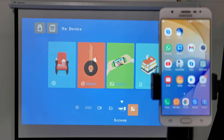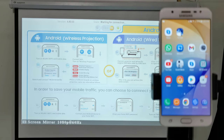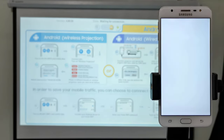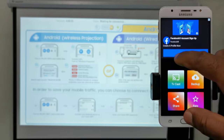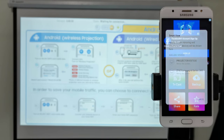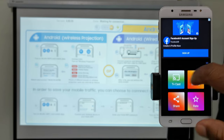Pairing your mobile device to this projector is fairly straightforward. You simply open the screen mirroring option, and pressing the OK button you can switch between Android and iOS. Then, using an appropriate screen mirroring app, scan for the Jimtab M22 from the list of detected devices and pair to it. Please note, not all Wi-Fi screen mirroring apps will work, as you need one that supports screen mirroring or AllShareCast depending on the device. Here I am using a new app called TVcast, and it's the only one compatible with this projector, as my regular Miracast app could not connect.